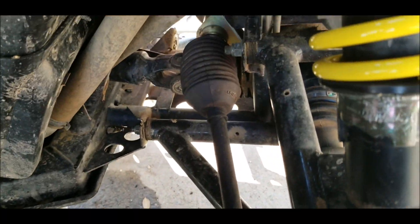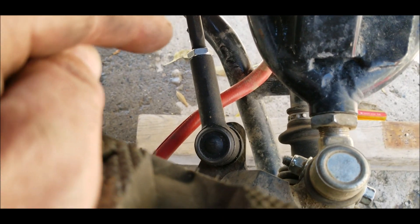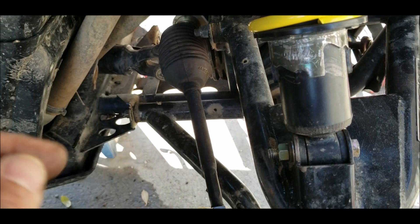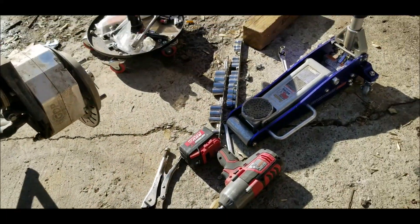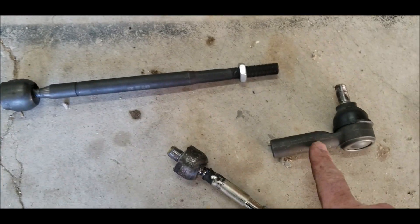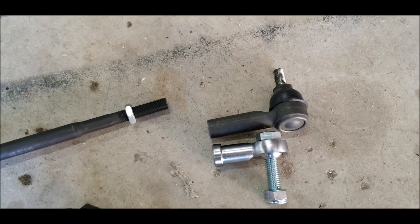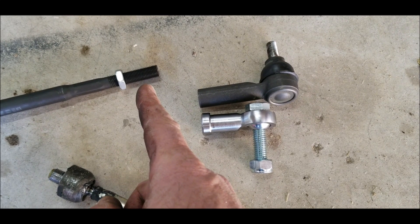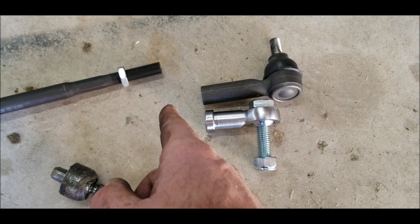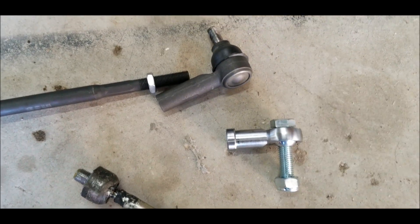Here it is on the other side, installed with the factory boot. I only had to do one thing to make it work: the outer tie rod fits in the taper and the inner tie rod threads into the rack. The only modification was taking this tie rod and cutting three quarters of an inch off the end of it — because of the length of the factory Toyota tie rod compared to the Steinjager heim joint. I left the nut on there, took my angle grinder, measured it out, cut it off, then backed the nut off to clean up the threads. That way my Toyota tie rod end goes on there and it's the perfect length.